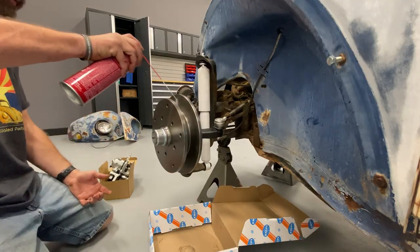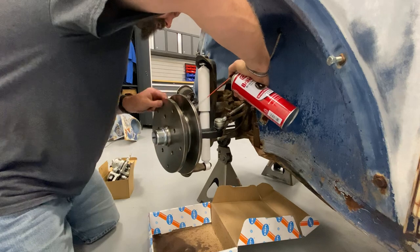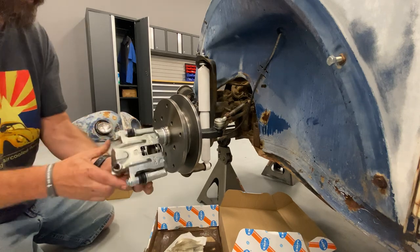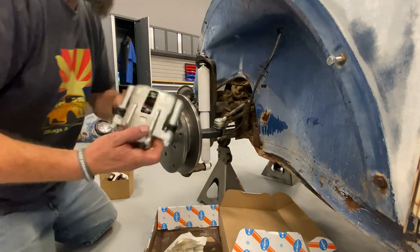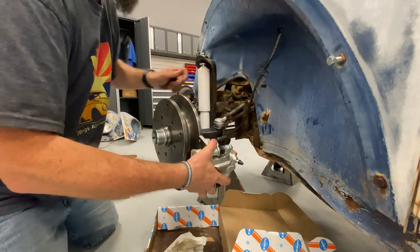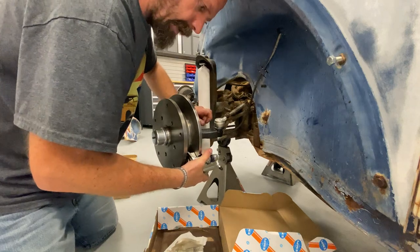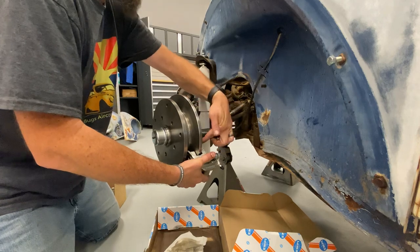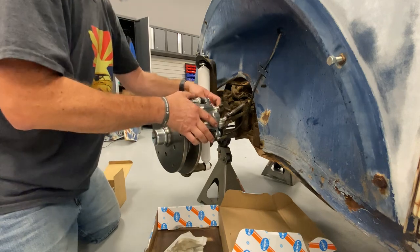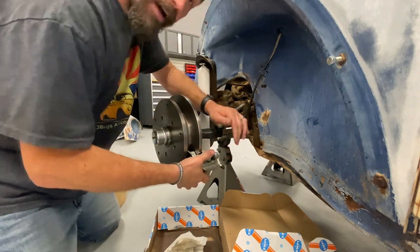We're ready to install our calipers, but before we do, we want to clean off any and all oils and grease from our brake rotor. Now we've got two calipers — if you mixed them up and don't know which is which, bolt it on so the bleeder is at the top of the piston. So this is the correct one. On these brake rotors, a lot of times to bleed them I'll actually unbolt the caliper from the bracket and rotate it up and over so the bleeder is at the top. That makes bleeding the brakes a lot easier. Quick bleed screws — I highly recommend them.